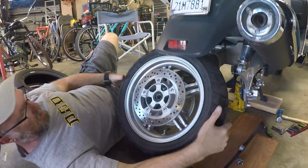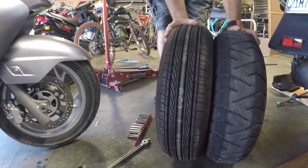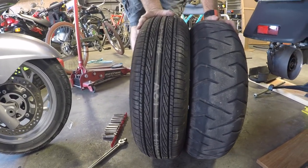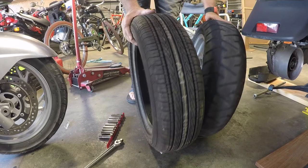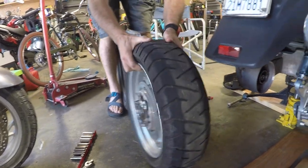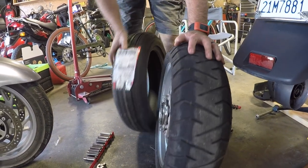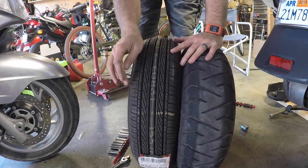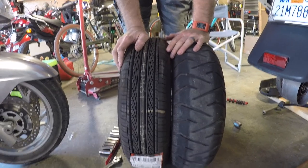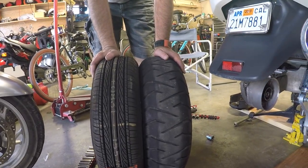She's out! Let's do a little size comparison — wow, there's a bit of a difference. But you figure you split that in half, and remember this sits up high too, so there's more room down below. I think we're gonna get clearance on that. Width-wise the car tire might even be a little narrower once it gets mounted, and it's going to pull the height down a little bit too. The old tire was more squared off and a little bit wider — it was just the very edge that was rubbing. We know for a fact the old tire was taller and wider, so we're keeping our fingers crossed. Now it's off to the tire shop.